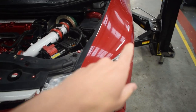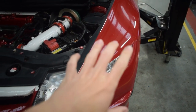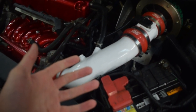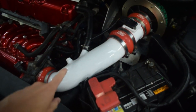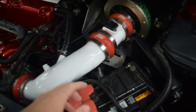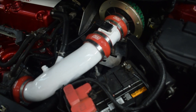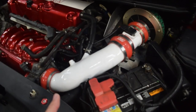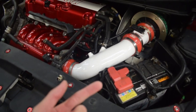Right, so we're here now. The car is literally just on the ramp, ready to go. I'm just off to the engine bay first. First thing we're going to do because we're sorting the clutch out first — I need to remove the HKS intake. The battery needs to come out because the shifter cables are underneath and they need to be disconnected, and there's probably going to be some bolts above gearbox-wise that we need to access. My dad's going to knock some wheels off and then we're going to send it up and have a look underneath.